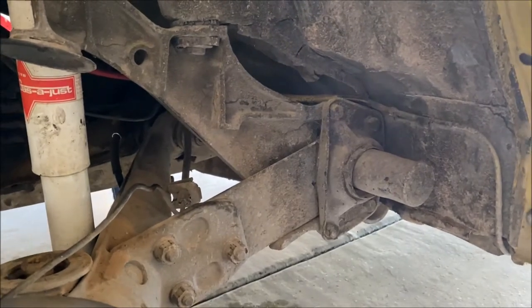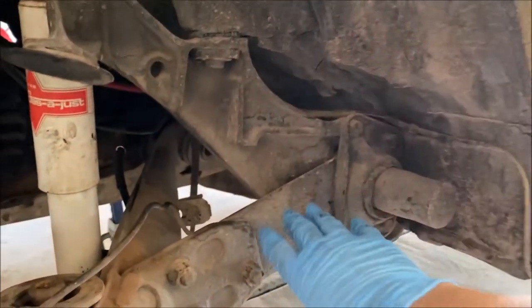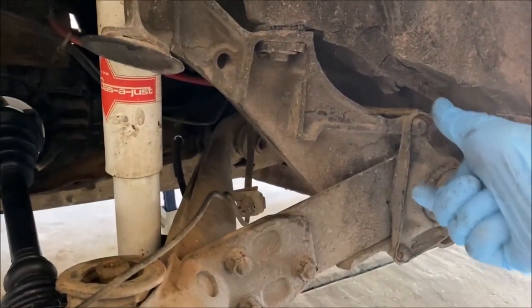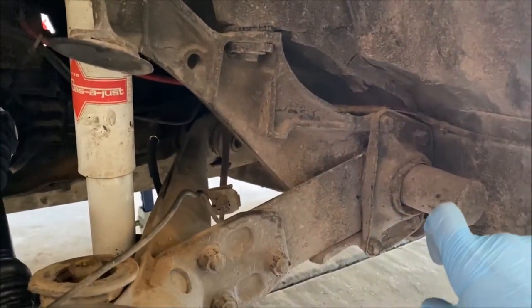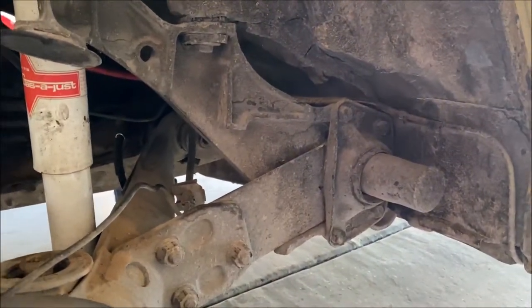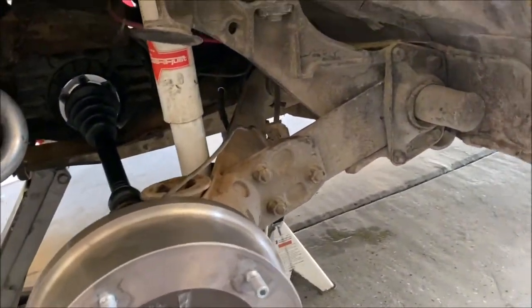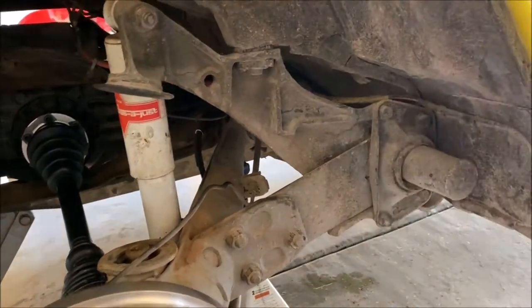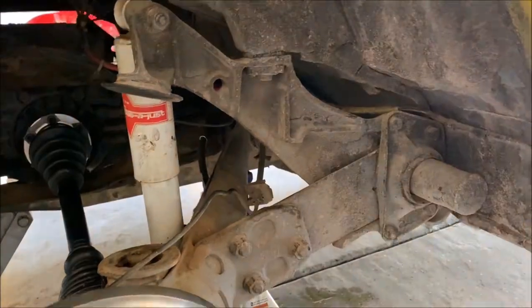To get close, I think Trav wants to get down about 3 inches. I think we looked it up and we were going to go up 3 splines on the inside and down 2 splines on the outside. We'll have to double check that, but he had a pretty cool chart he saw on Samba or somewhere that gives you the number of teeth and the measurements. So we'll be referring to that, and I'll probably drop it in the link below.